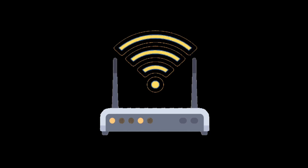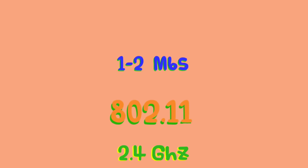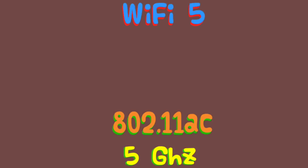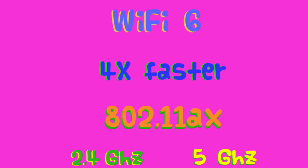We need a good WiFi system to ensure a good connection to the internet. WiFi started in 1997 with the 802.11 standard at a maximum throughput of 2 megabits per second. It improved in 1999 to 802.11b at 11 megabits per second, then 802.11g at 54 megabits per second, then 802.11n — retroactively renamed WiFi 4 by the WiFi Alliance — which many devices today still use. Then WiFi 5 (802.11ac), which only uses the 5 GHz band with faster speeds but less range. And finally WiFi 6, which improves on both speed and network traffic handling.